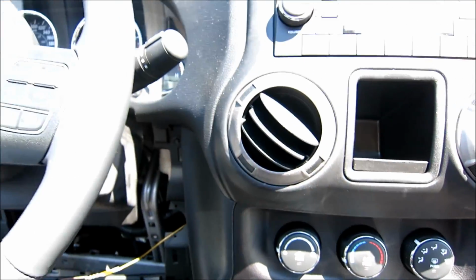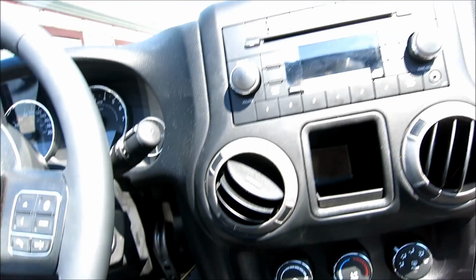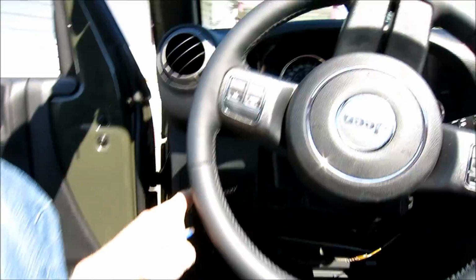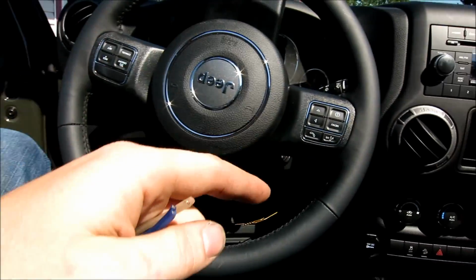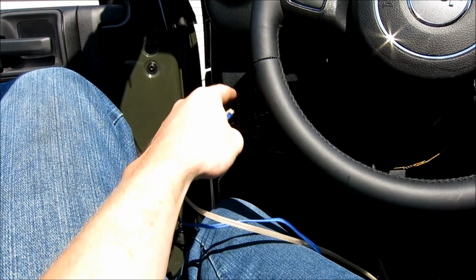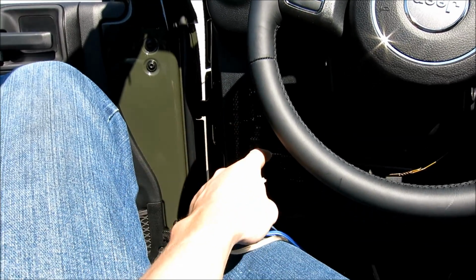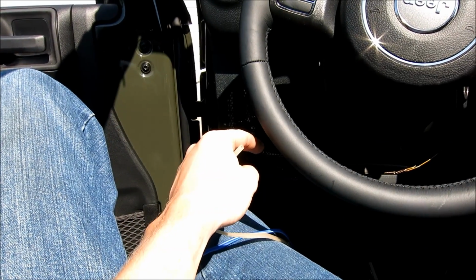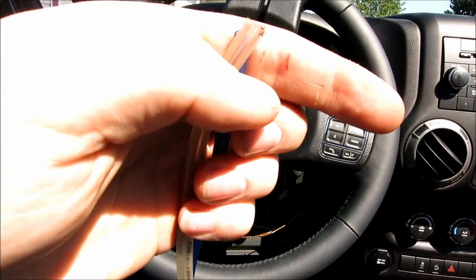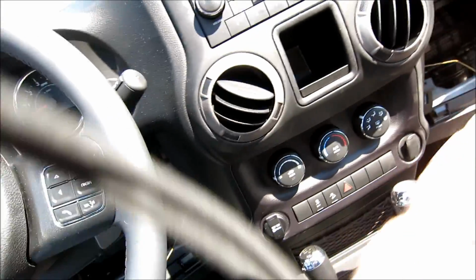So I'm just going to tape 2 wires on here. One's going to be tweeter, one's going to be woofer wire. And I'm just gonna feed these over to here so that way I can wire in my crossover. If you've got your crossovers and they're super tiny, but you're running a 4-channel amp, you're just gonna be grabbing the crossover wire, which says 2 amplifier or 2 whatever it says. It'll probably say input, and then I'll have tweeter and then woofer on it. So the input wire is the only one, so you only need to run wire. I need to run 2. So I'm going to tape this onto here and pull this through the vehicle.